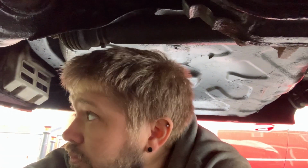It's not the best. Well, people may say it's not the best stuff, but it seems to be doing the trick, and we'll see. As you can probably see, we've done all the underneath of the boot. That kind of process, so a rust treatment, a black rust preventative paint, and then an underseal on the top. So we've put a few layers on, so hopefully that will stop it. We took it back as best as we could and then did that.